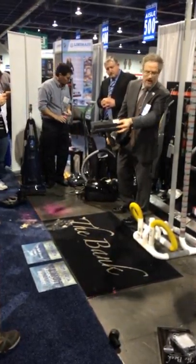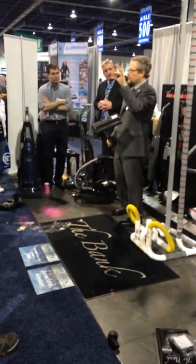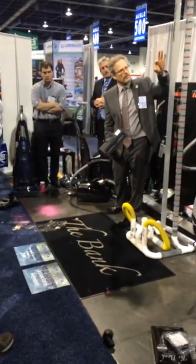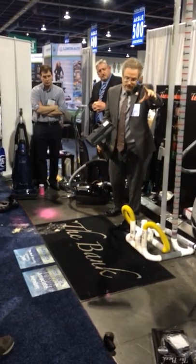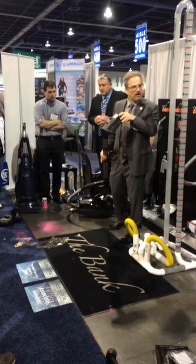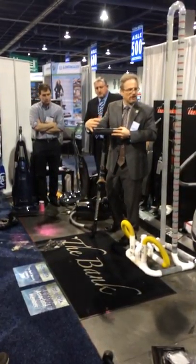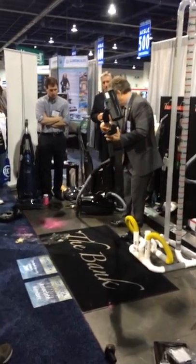You see the narrowness of that brush roll — how skinny it is? The problem with all the other power nozzles I've seen is their intake is rather large, giving more surface to grab the throw rug, but also giving you less airflow. The larger that intake, the more airflow you're going to lose at the nozzle end. But this one here works beautifully.